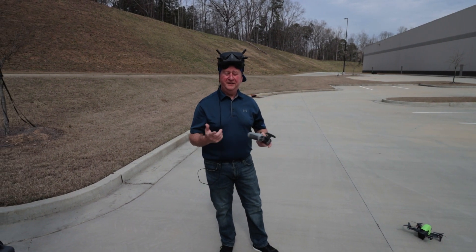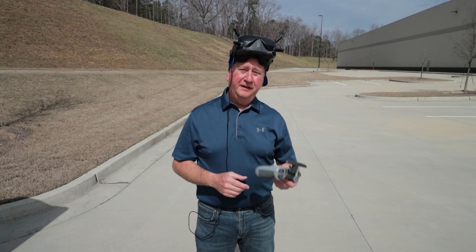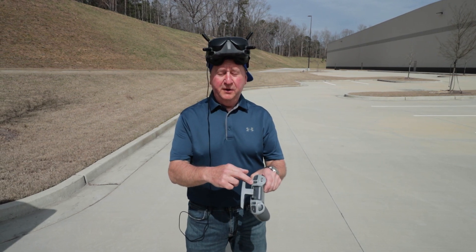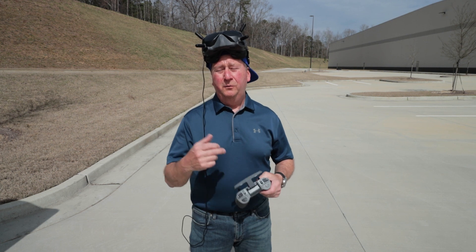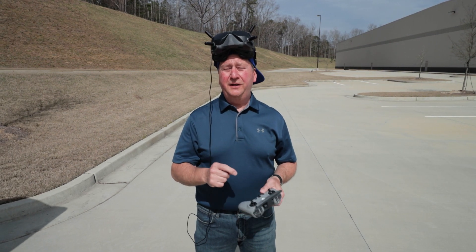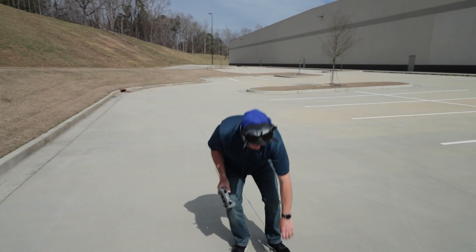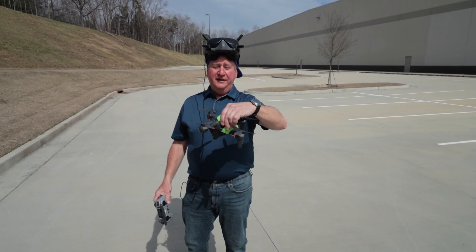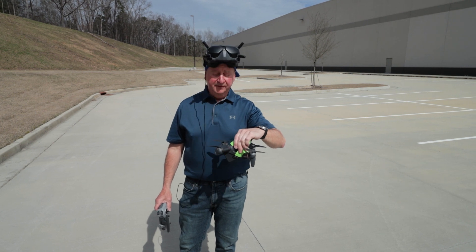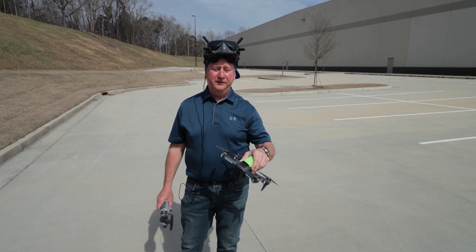How many quads can you fly in manual mode and then turn around and have it land automatically? From DJI, this quad is only available in normal and sport mode by default — you have to activate manual mode separately. Once you're in manual mode, there are actually four different things you can change. One is the angle limit in manual mode, which you can't turn off until you've done one manual mode flight. That limits your pitch to about 45 degrees forward on the first flight, which feels really strange coming from full acro with a regular FPV quad. Once you turn that off, it feels natural.